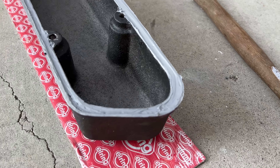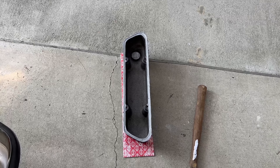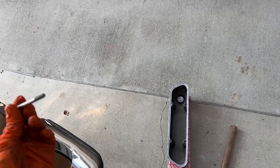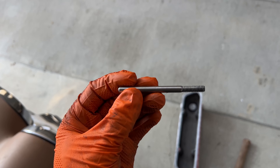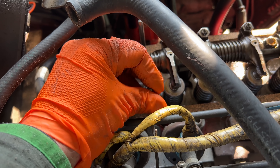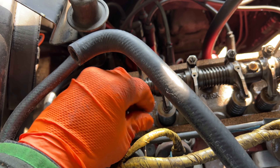This cover is aluminum, and it needs a little bit of RTV to help seal the cork around it — that's what we've found over the years. But only on this side, not on the head side. These little dowel pins have been very helpful for getting that alignment to set down just straight on the gasket.